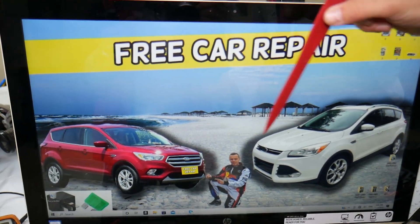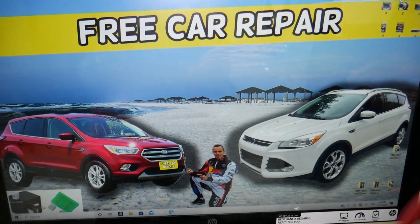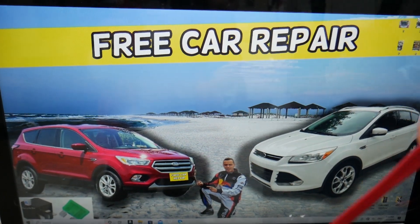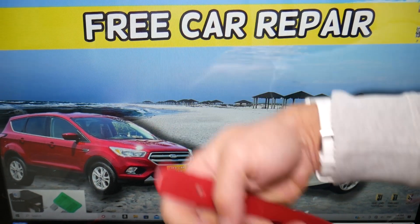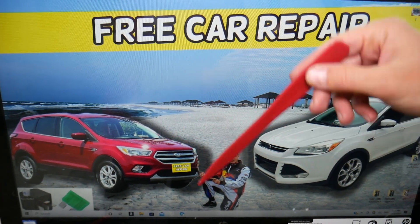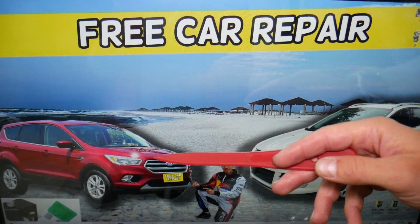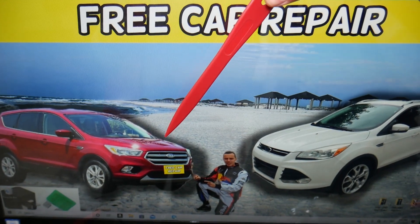This is the model before the facelift, this is after the facelift, but it should work for both. If the left or right headlight does not work, it could be a bulb. Always check the bulbs first — that's the easiest thing to do. Make sure the bulb is connected all the way, because some people can't see behind the headlight and didn't install them correctly. If everything's good, check the connector for the headlight wire. Sometimes it could be loose or exposed to humidity and have some corrosion buildup, especially if you live up north or in a more humid climate.